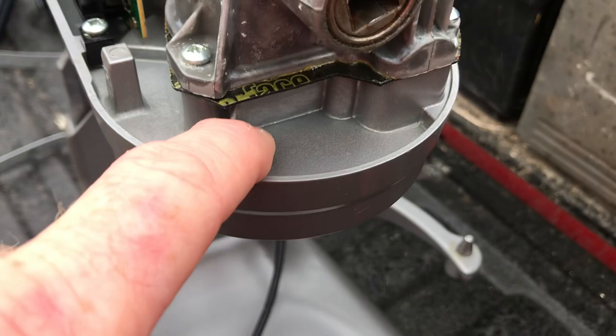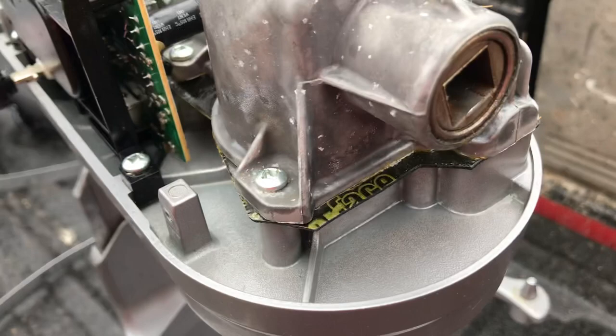When I first pulled it off, this area here was the first thing I saw and it was full right up to the very edge with blood and maggots swimming everywhere in it. Blood was all around here and down in there. You've got to clean way down inside there — long q-tips helped a whole lot. Be careful with any cleaner you use since there's electronic stuff here; ammonia will corrode those connections, you don't want to do that.